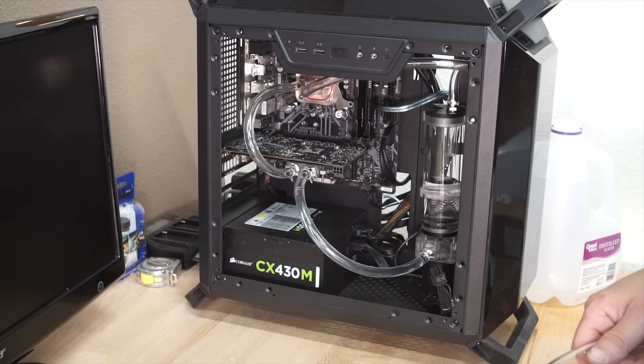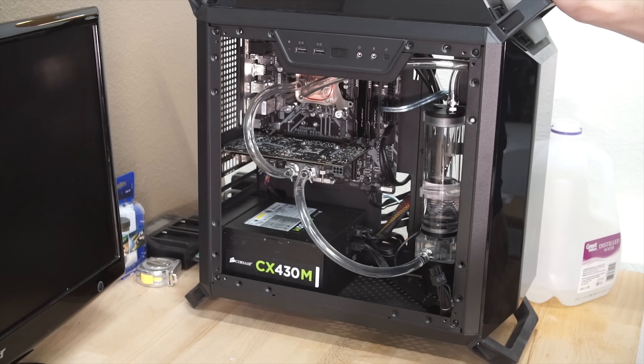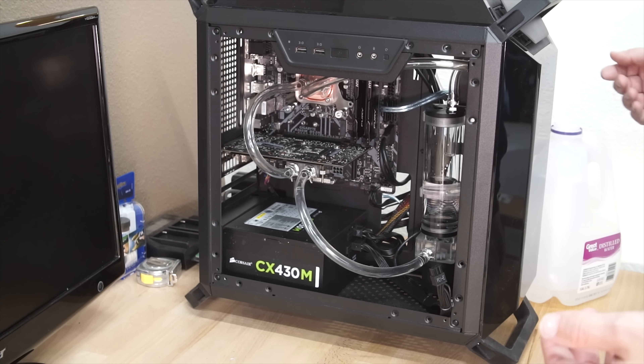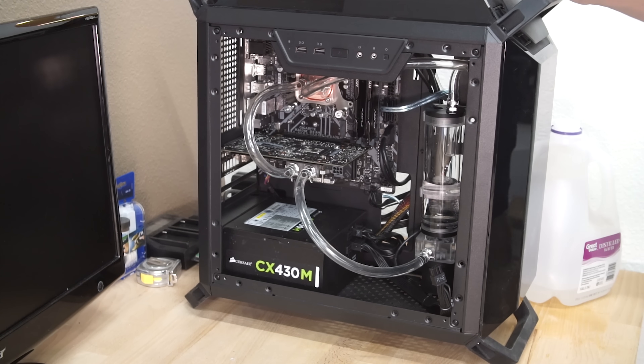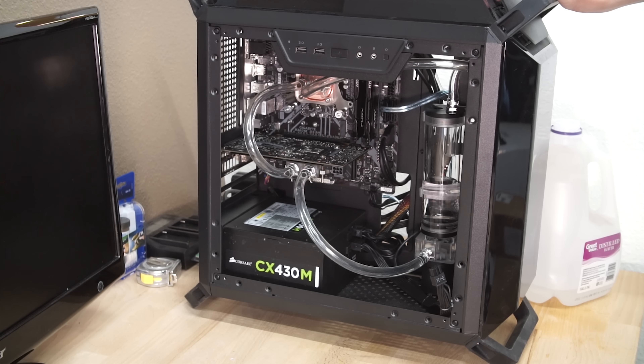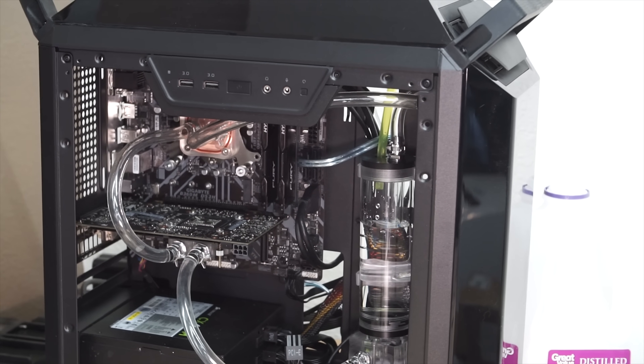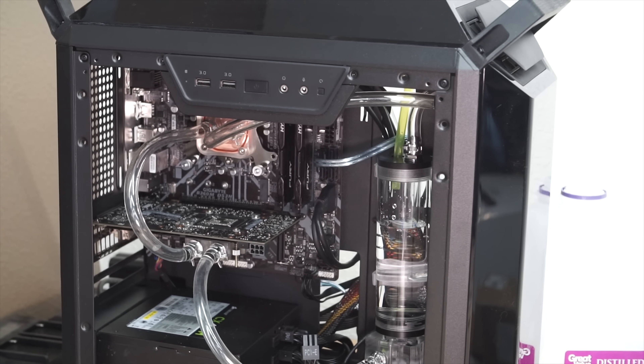Attempt one to fill was a total fail. I was trying to do things properly by putting a fitting on top of the reservoir and using some tubing I already had. The problem is I created a vacuum in the system, and as soon as my tube got full it wasn't letting any air in, so water just started spilling out the back of my tube. I ended up soaking my 24-pin connector and the header going to the pump. I guess there's a reason they included that janky funnel. Take two — I improvised and used the aerator from a baby bottle to get this filled, and it seems to be working. So onward and upward, let's get this show on the road.